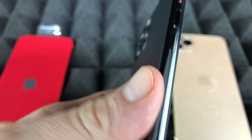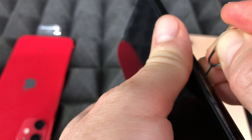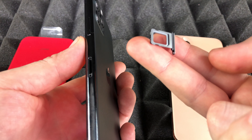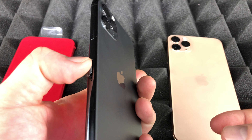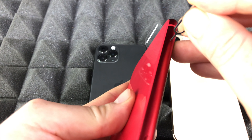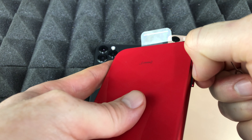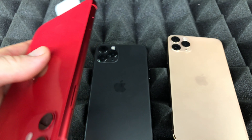We're just going to close it up and there's our SIM card inserted — that's it. It's the same deal whether you have an iPhone Pro. The tray comes out just that easy with some force. And with the iPhone 11, the hole is just slightly down here — the same thing pops out and we insert our SIM card right in there.